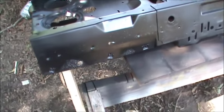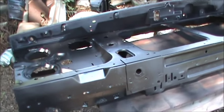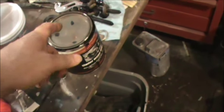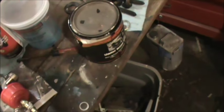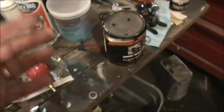This is the Eastwood under hood black and this paint has been in this can since I bought it to do my diesel truck about five years ago. It's been stored - I'm sure it's been frozen a few times. The can had kind of pooched out a little on the ends and when I popped it open it popped like it was under pressure. It's kind of messy but you do mix it with lacquer thinner - you can mix it anywhere from 100 to 150 percent lacquer thinner, so one-to-one or two-to-three. I just mixed it one-to-one because I wanted it to be a little thicker.